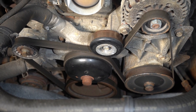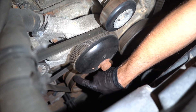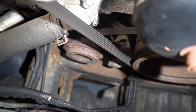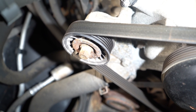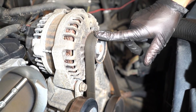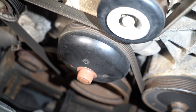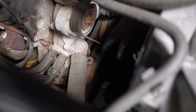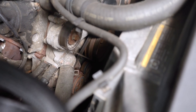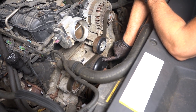So let's take a look at this belt system on this vehicle while the belt is still there. You have the crank pulley down below. The belt is gonna be driven by the crank pulley and it's gonna go up here, and there's a tensioner and then an idler pulley. You have the alternator, you have the power steering, and we have the water pump. Now on a different belt, you have the AC compressor. If you're broken down on the side of the road and you need to get home, the AC compressor is not gonna be important. Neither is the tensioner pulley or the idler pulley. But you are gonna need the water pump to be spinning and you want it spinning in the correct direction.